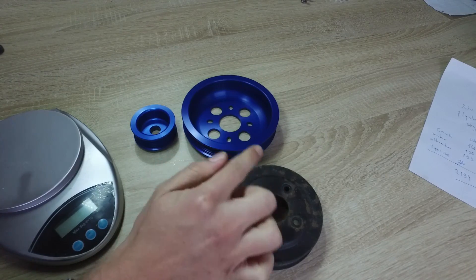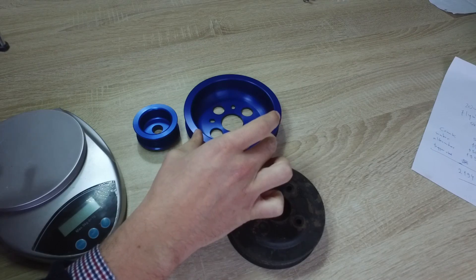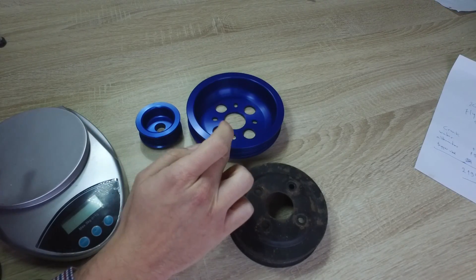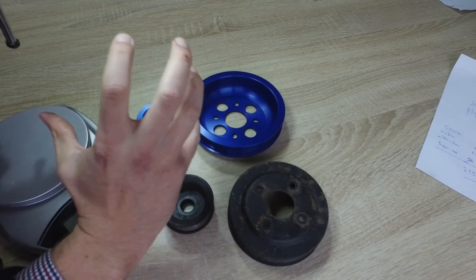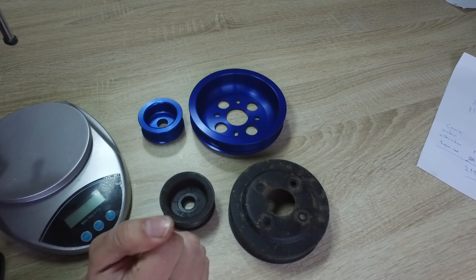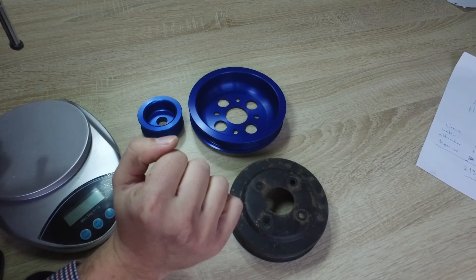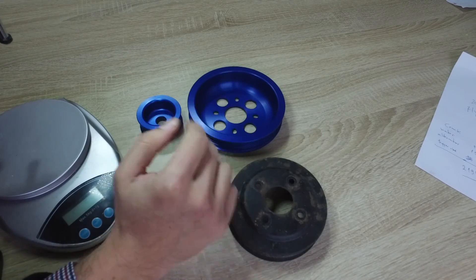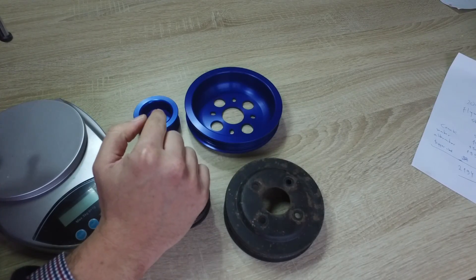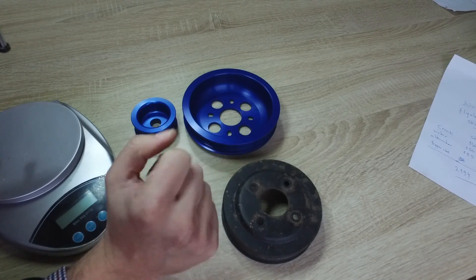This also means you need to find a proper V belt to accommodate the slightly larger water pump pulley, or you might be able to get away with it by adjusting your alternator on its bracket. I don't know yet for certain if you need a new one, but we'll know once I start assembling my engine.